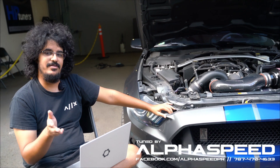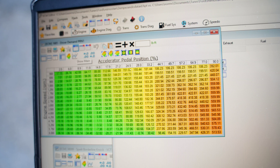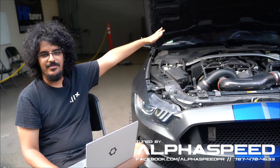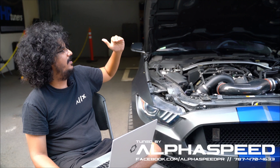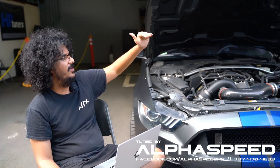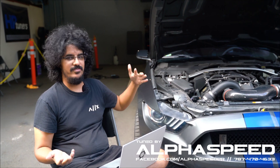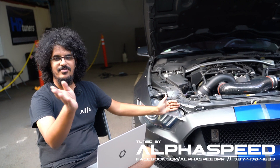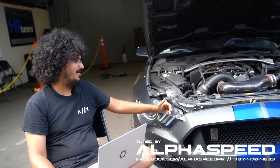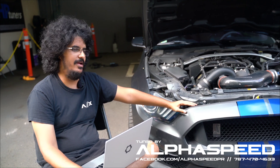You also have a driver demand table that relates your throttle pedal position to the expected or required torque. The accelerator pedal position tells the system how much torque you want, and then the powertrain control system figures out how to make that torque. It goes to the torque table, checks the load and RPM, and determines how much torque should be produced. If the values don't match, it'll start going crazy. Also, if you try to use traction control and one of these two tables is not up to spec, it'll either throw a wrench light or disable the entire traction control system — and then you'll spin everywhere, probably running over pedestrians. So when tuning a Ford, you always need to make sure all torque tables are correctly calculated and at least somewhat close to reality.